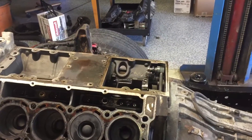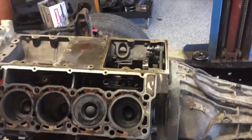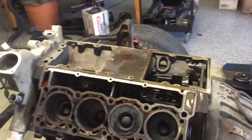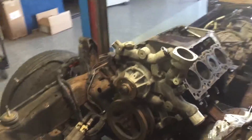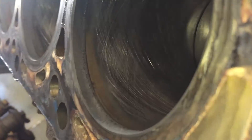With as far as we're going in, let's refresh it. I mean, can we put it back together and have it run? Yeah, it'll run — it ran when it came in. But is it right? It's got 200,000 miles on it, stock EGR system in place. You can kind of see them really good there. When you go up top — combustion leaking past the top ring.